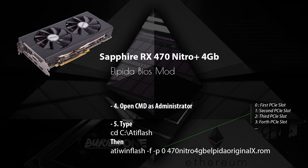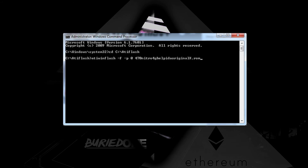The next step commands are in the description below — you can just copy and paste them. You'll need to open CMD as administrator and type the commands. On the last command you'll see a 0 marked in green: changing it to 0 flashes your first GPU, changing it to 1 flashes your second GPU, and so on. If you've done everything correctly, the command output should look like what's shown on screen, then press Enter and it starts flashing.